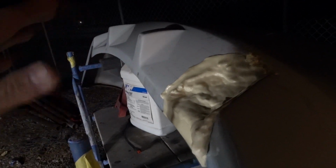because I want to plug up this hole right here in order to make this bottom piece of the Camry rear bumper. I want to make a mold of it and make it carbon fiber. That way I can cut it out right here all along and then bolt the new carbon fiber one on here. That's kind of the game plan with that. I'm just waiting for that to dry so I can give it another coat with the expanding foam, and tomorrow I can just shave it down. So that's kind of what I'm doing tonight.